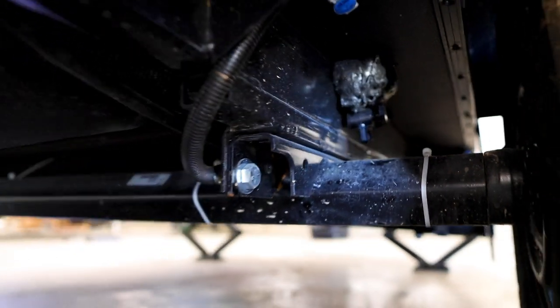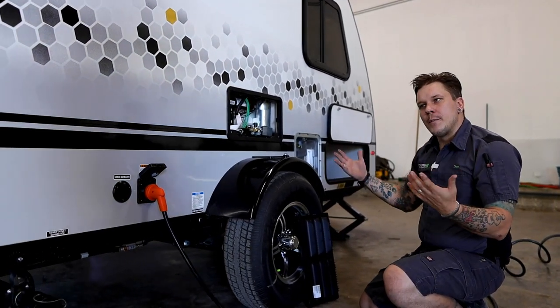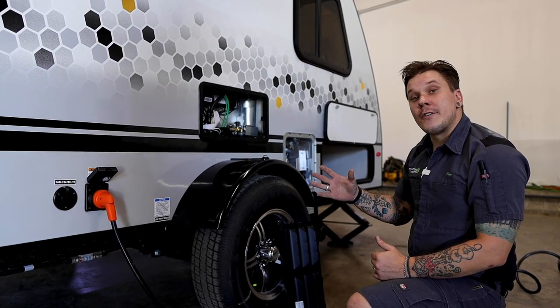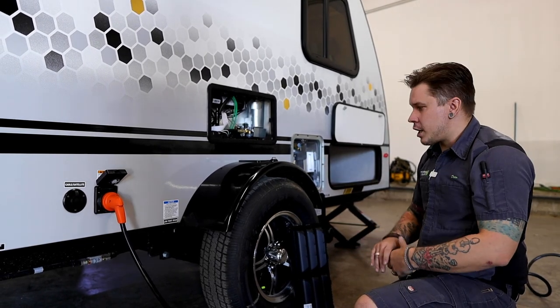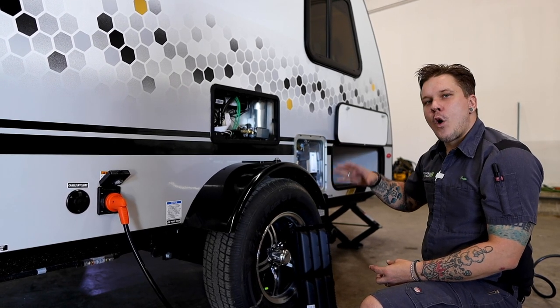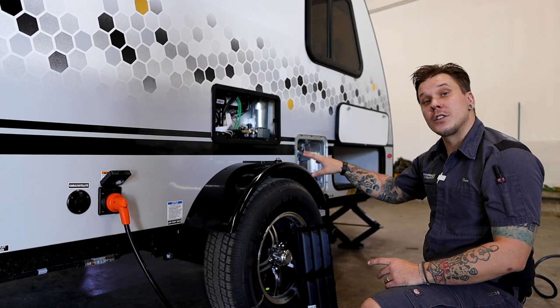Now those are going to be the lowest point in the unit's plumbing. That becomes important when we are trying to purge the water from the unit. And keep in mind that if this unit is going to be in storage for more than 7 days, we need to evacuate all of the water from the unit. We've already looked at the freshwater drain location. This is going to be part of that procedure. This is going to drain everything in between water source and fixture. So all of that in between plumbing is going to be drained from this location here.